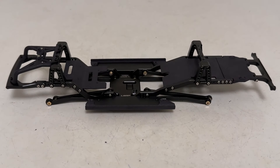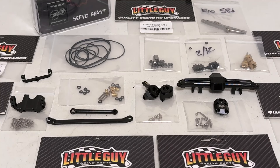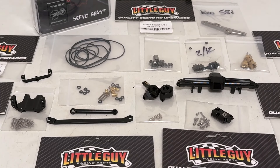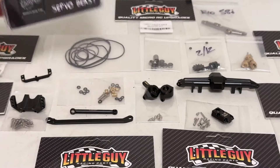Next up we're going to focus on the front axle assembly. Continuing that midnight theme, I picked up their new black brass front axle. Prior to this they only offered those in the raw brass polished look, so now you get a nice black brass diff cover as well - super nice. And then I picked up their knuckles, their steering links, and their servo tray in black as well. A front axle bearing kit, I picked up some 212 overdrive from little guy. The plus one hex is here, and then for the actual inners I've got the XO Super 8 U-joint inners - those will give me 55 degrees of steering, nice smooth rotation.